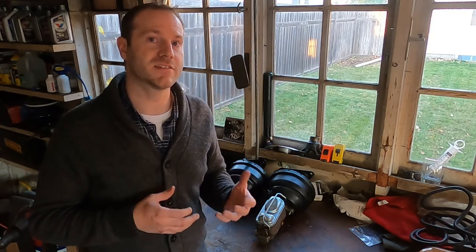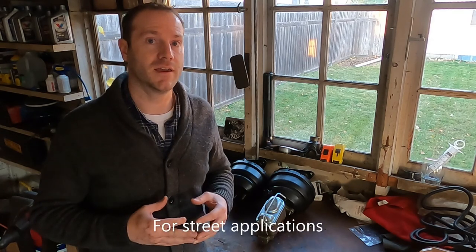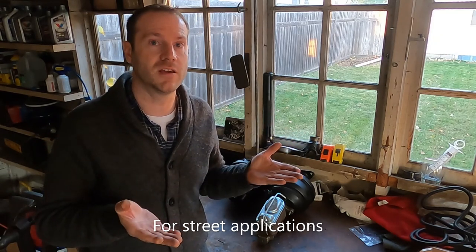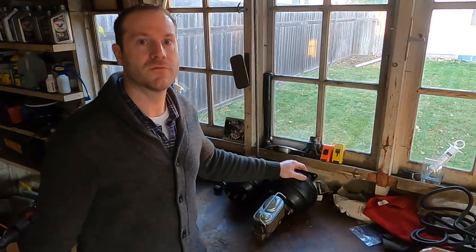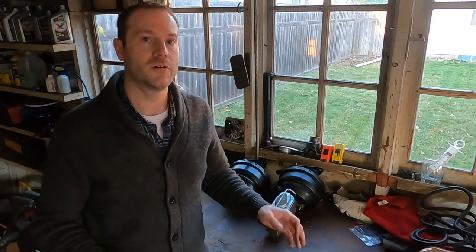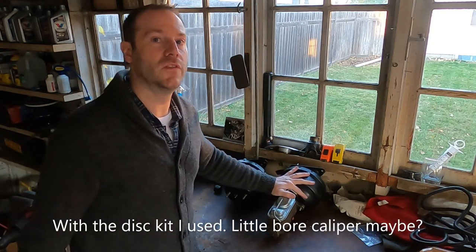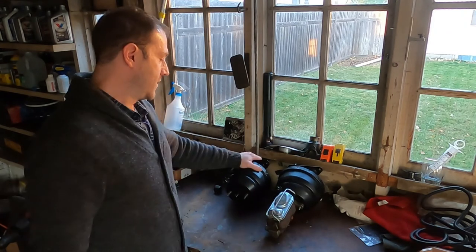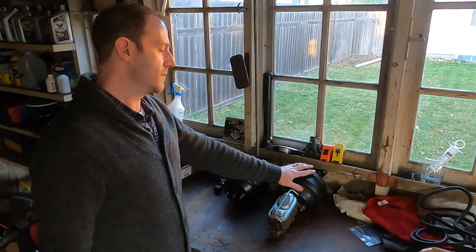Those are a bunch of medium to small issues with drum brakes that you can solve by going to disc brakes. The biggest issue — and the reason why I strongly recommend against anyone doing a four-wheel disc brake conversion to a classic Mustang, especially '67 through '70 — is that it's not compatible with your braking system. This is a power brake booster from Master Power Brakes. It's a kit — it came with a master cylinder — and it said it's good for both front disc/rear drum and four-wheel disc. It is not. This will not work with four-wheel disc.